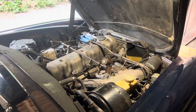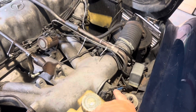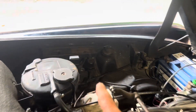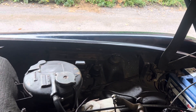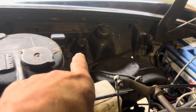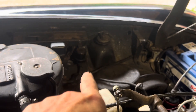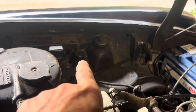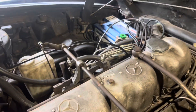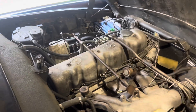To summarize: if you're having a problem starting your Pagoda when cold, check that you've got voltage across the cold start valve, check your cold start relay, and make sure the contacts are clean — use a little contact cleaner if needed. The timer relay next to it: when the engine is cold you can unplug that and the car will still start, so it doesn't come into effect until the coolant is above a certain temperature, which depends on the age of your car and which starting aid version you have.